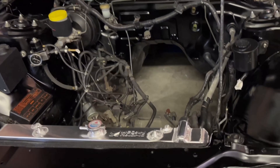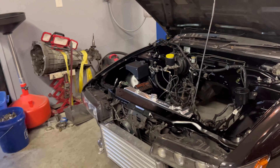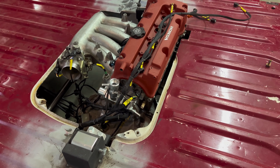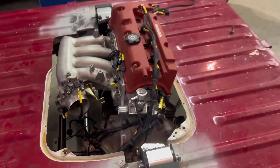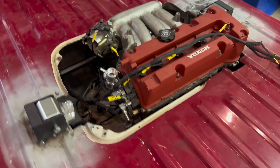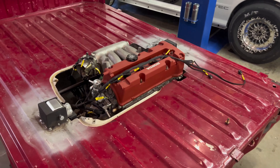I got the engine out to do the work on it and then found some rust in the engine bay, so I ended up painting the entire engine bay — it got carried away. But I'm very close to having this put back together; I'm waiting on a couple more parts for the motor. Due to the overall tight fit of the swap in the Acty, the engine's got to come out in pieces. I'd imagine in the future I could leave the intake manifold on, but right now I definitely have to separate the engine and transmission to pull it out from the top. With the way I've braced the front and the way the suspension runs in the rear, I can no longer come in and out from the bottom without completely unbolting the entire suspension.